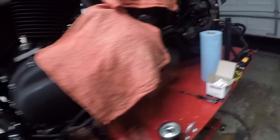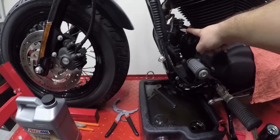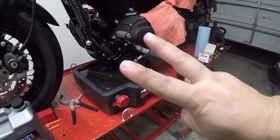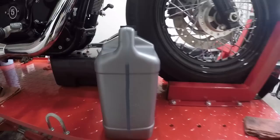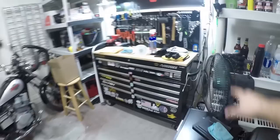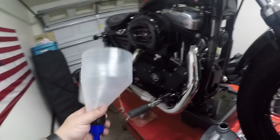Now we're to the point where we need to add oil back to the bike. The Sportster 1200 calls for two quarts. We did put a little bit in here already, so we're gonna add a little under two quarts. Harley recommends having the bike on the kickstand — or the jiffy stand as they call it — run it for a little bit, make sure the oil light on the indicators goes off, and then check the levels from there. We add oil on this side right here. I'm gonna use this cool little measuring thing that I've got. I will include a link in the description to all the stuff I'm using here, from the oil to the filter to this little measuring tool.